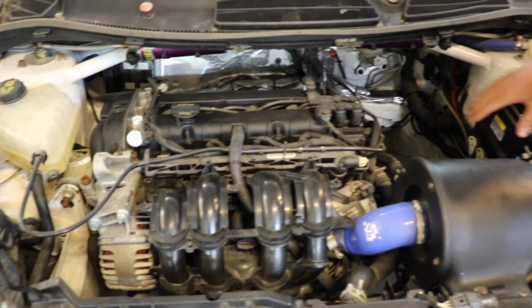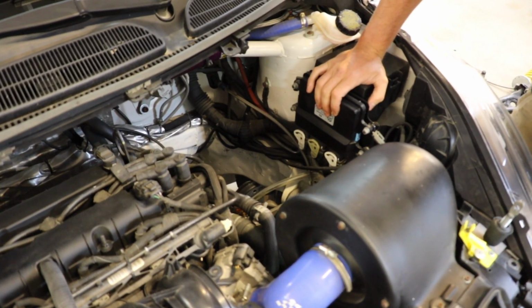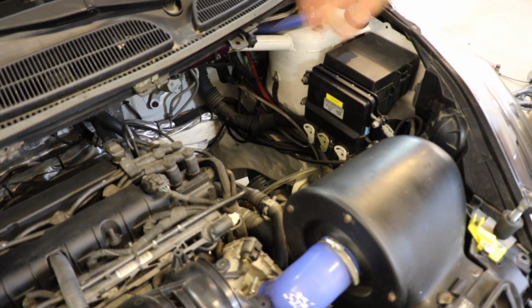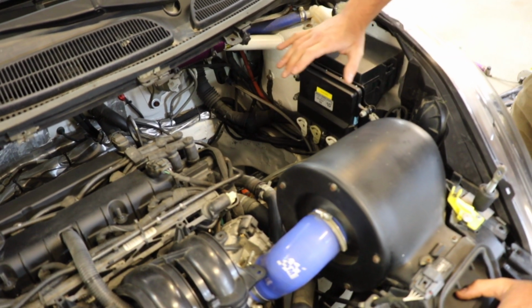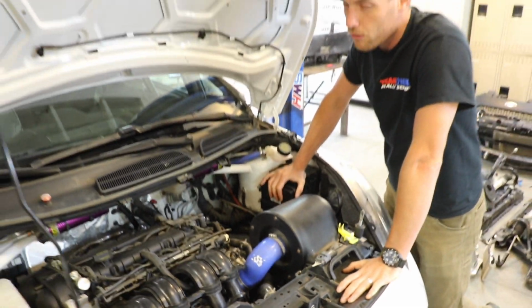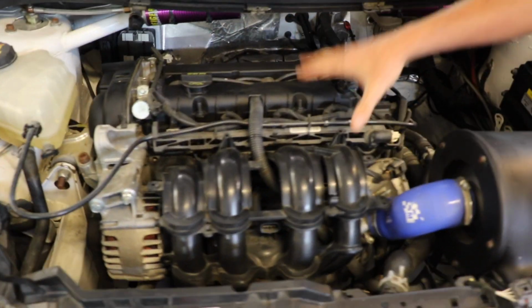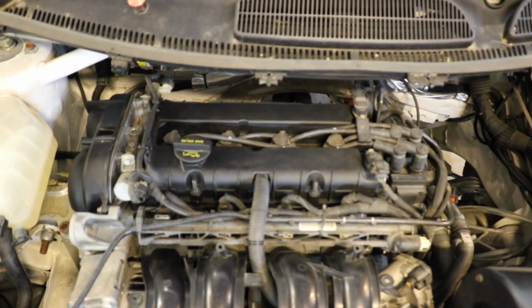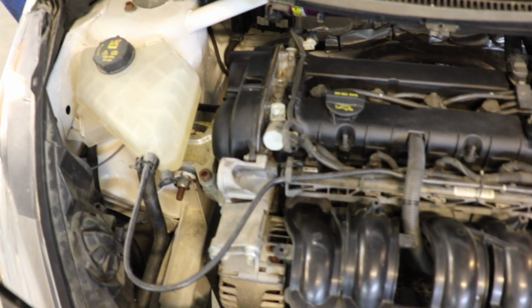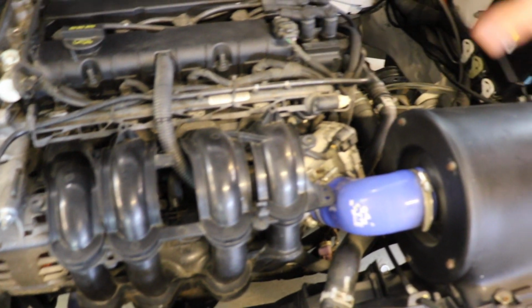This thing's got a high-speed ECU, it's got different engine mapping, which is just the tune on the engine. The rev limiter is changed, and it's got some different stuff going on in here, but really nothing too fancy. This is really just a 1.6 liter 4-cylinder engine. It does have pistons from M Sport in the UK. It's got some headwork done to it. It's got bigger cams in it, obviously an intake and things like that.